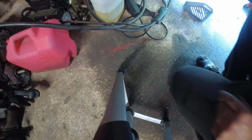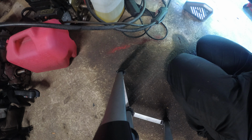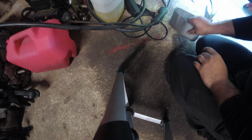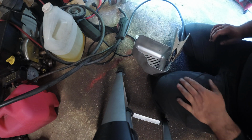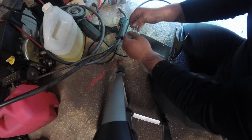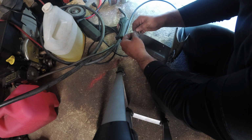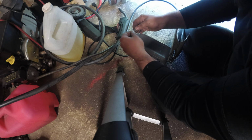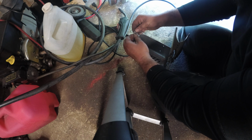And you know, I'm not sure what I want to do. If I'm going to try and control the puddle. Oh, it actually broke. The weld actually broke. I don't know if I'm going to try and control the puddle, or if I am trying to just tack it, you know, here and there. Because remember, I don't want to burn through the metal, because this is pretty, you know, thin.